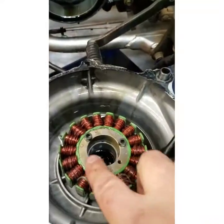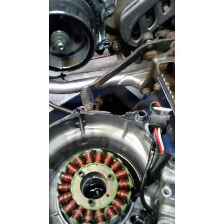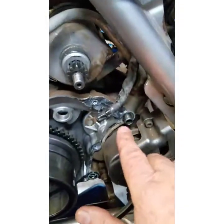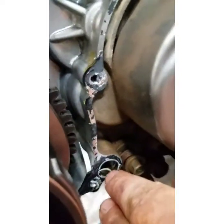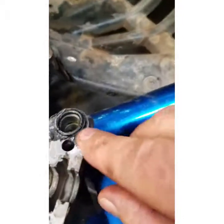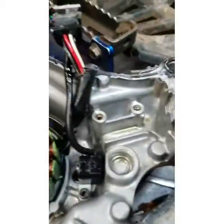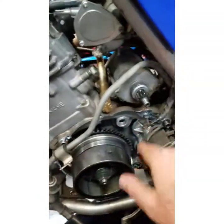Now it's all about these three screws, these two screws. Get the gaskets cleaned up on the engine and the cover. You've got your three dowels — one, two, three. The dowels will have O-rings around them, so pay attention. You can go to partzilla.com and look up the original Yamaha parts fiche and see exactly what goes where if you need to.